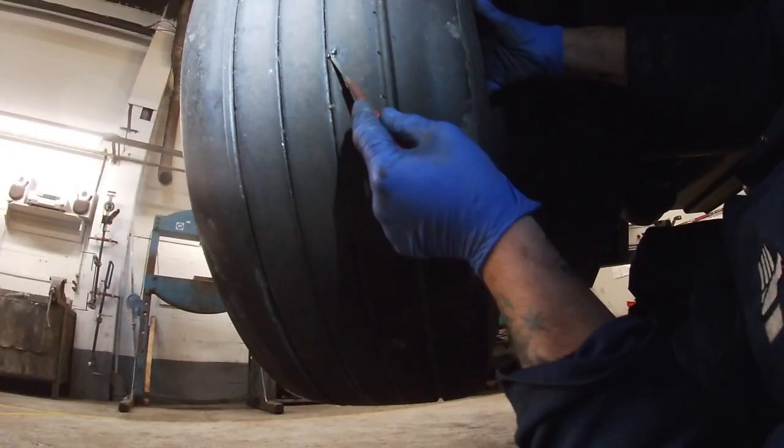You don't want tires standing around for years, especially on a vehicle with weight on it, because that will deform the tire over time - even on axle stands it will degrade. I have seen tires explode from vehicles that have come out of storage - they looked fine from the outside until they started to be worked, at which point the cord structures, which are stressed continually when rolling, began to fail. The more weight on them, the more stress. With commercial vehicles they wear out very quickly. Anyway, that's just something to note - I hope it's helpful. Until the next video, I'll see you later.